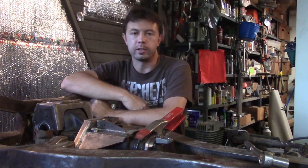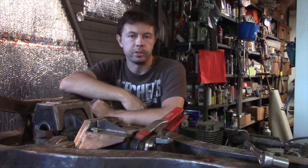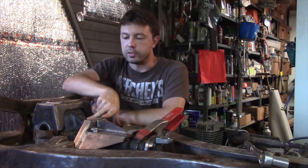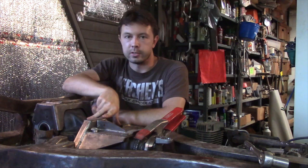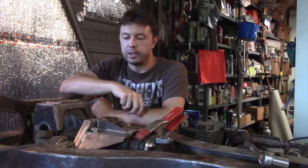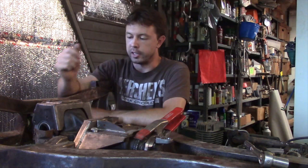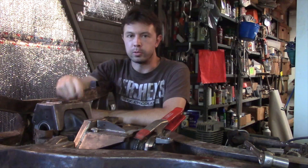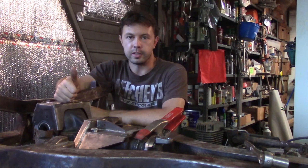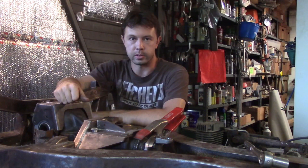A pretty common thing to do with the Spitfire GT6 when you're upgrading the power or sticking an entirely new engine in it is to upgrade the differential. Probably the most common thing to do is take the Subaru R160 differential — the early ones, out of the Datsun 510 in particular. One reason is it's not going to explode as easily as the stock Triumph differential, especially the 327 that I was going to be using.